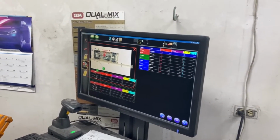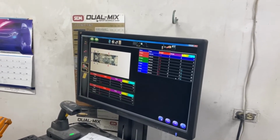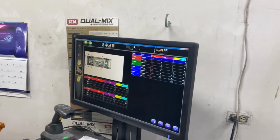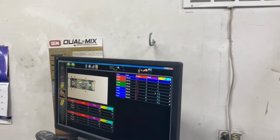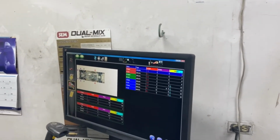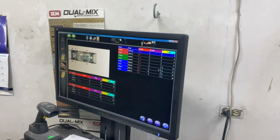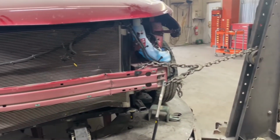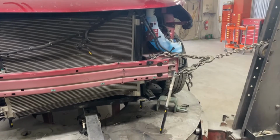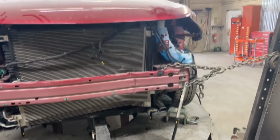What I'm after is these 2 points right here. D left is the driver's side, it's in 4 millimeters. The D right is out 8 millimeters. My other ones are coming around. D right is 1 millimeter wide. D left is the front cradle bolt, and that's, well, let's see, D left is in 3 millimeters. So I need to go a little more. Let's see what happens. You can watch the hood gaps, you'll see the whole front end shift.